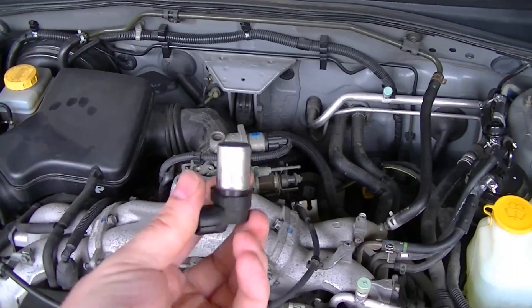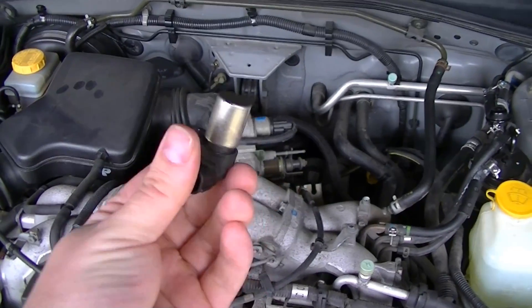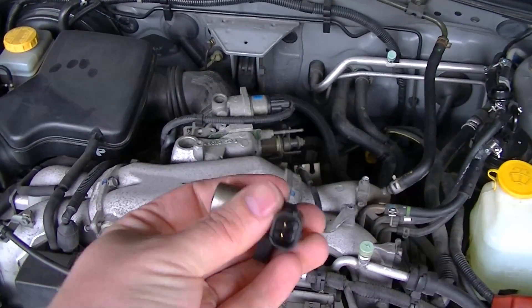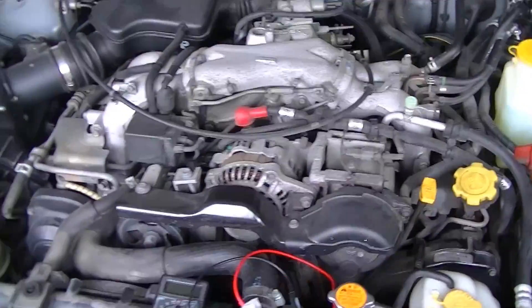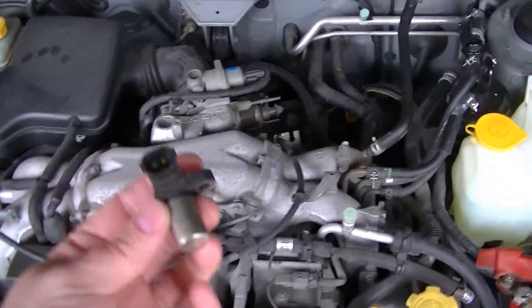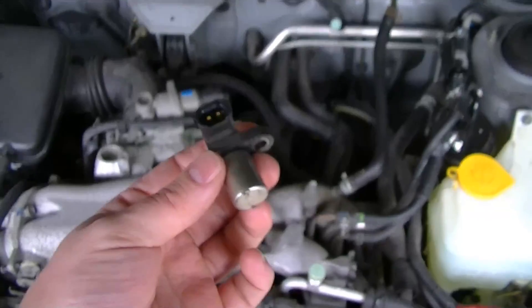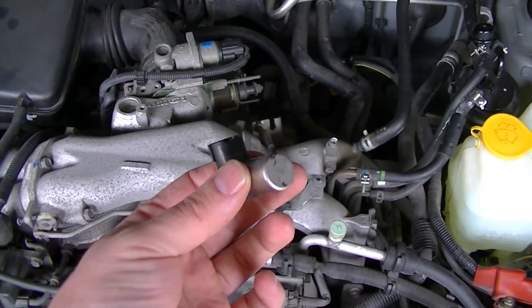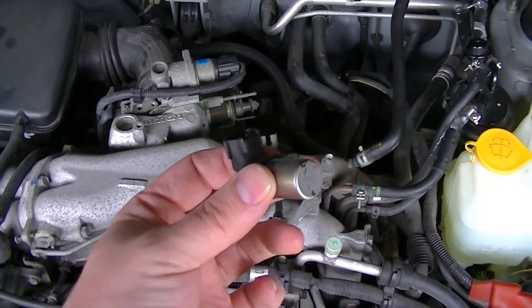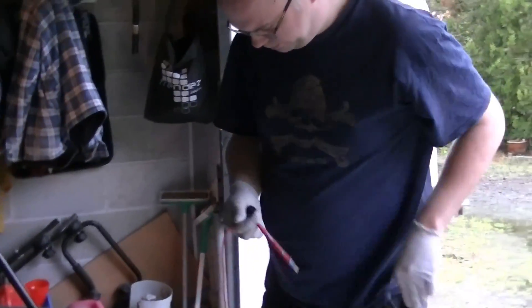That gave us a little bit of direction. For the crank sensor, I just pulled it out and it's open circuit. These Subarus are a bit of a nightmare to get to anything, but I'm going to call it at that — as long as they're not too expensive — and we'll stick one in and see what happens. I'm pretty confident that's the badger: a broken crank sensor.